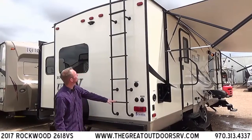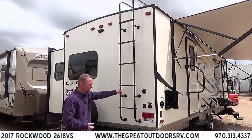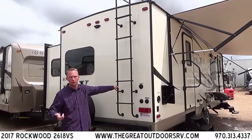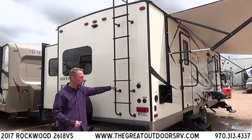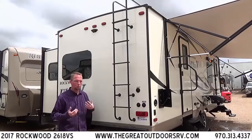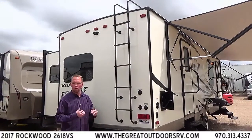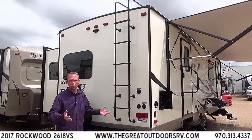You do have a full walk-on roof, and it comes with the ladder already on it. It's not really meant for storing things, but it's a great way to get up at the beginning and end of the season to check all your seals. I always tell customers to just feel them — if your seals are still soft you're probably fine, but if they start to get hard and brittle, that's when you'll want to reseal or scrape and reseal depending on the age of the camper.